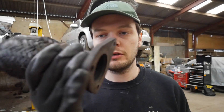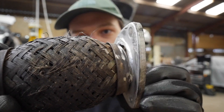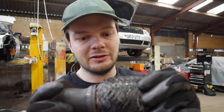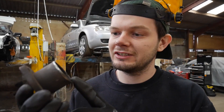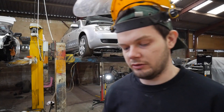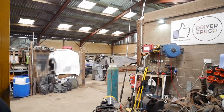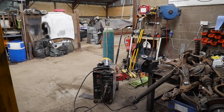I'll try and find something to have a go at welding together before going ham on the only bit of exhaust pipe I've got for this car. I've got the original flexi and output flange from the turbo, and the flange we cut off that we don't need. So what we're going to try and do is weld those together. Just had a thought that because the flexi is broken, we might not be able to earth it properly. Decided to get rid of the flexi and just do flange to flange.